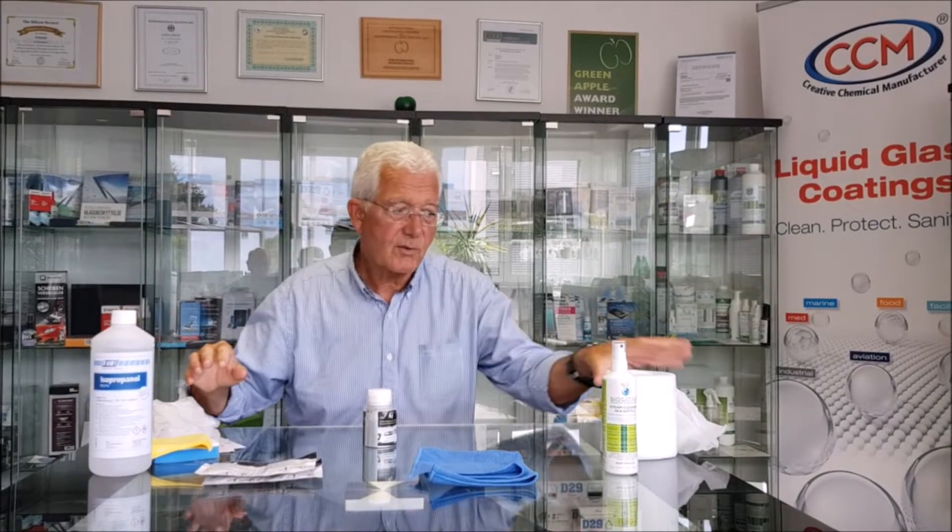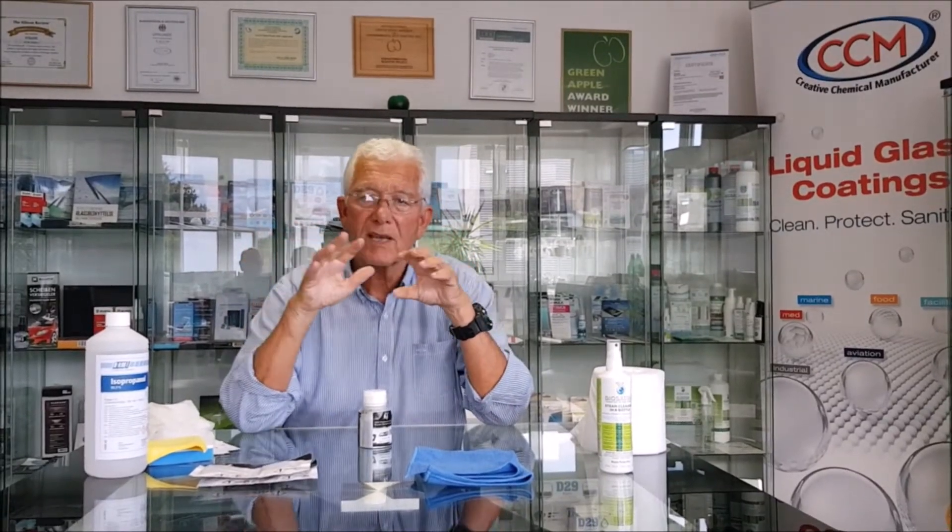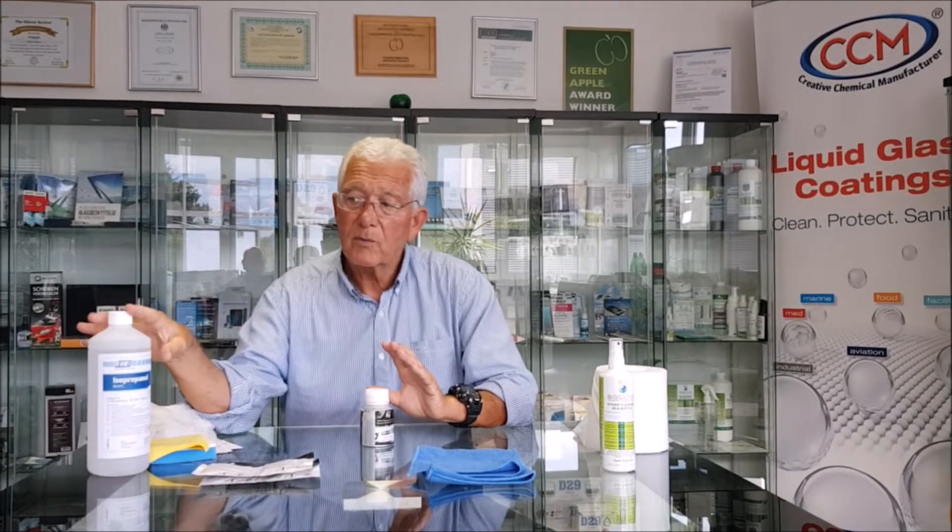When the car is washed, we then wipe the surface with the isopropyl alcohol. Fully moisten the cloths with the isopropyl alcohol and wipe that over the surface — it will also latch onto any remaining water droplets. It also acts almost like a primer, making the coating more readily absorbed onto the surface. Wipe down and then buff the surface — you can use this microfiber, another cloth, tissues, or the application wipes. After wiping with isopropyl alcohol, buff the surface. It's so important to have a completely clean surface — I can't stress that highly enough.